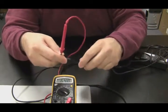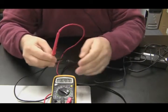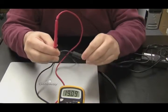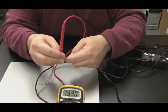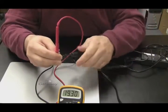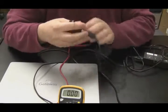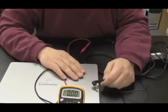To be thorough, take the power adapter and bend it around a little, making sure it's maintaining a good connection. I'm still getting 19 volts while jiggling it around and making sure there are no crimps in the wire. Even after moving it around, it's still reading 19 volts, so we know the tip is good. A lot of times the tip will break right at the end and you won't get that 19 volts after it's broken.